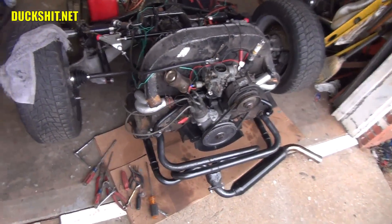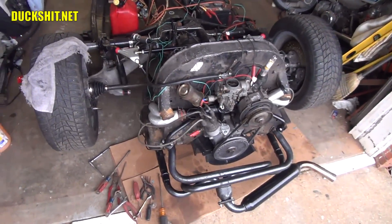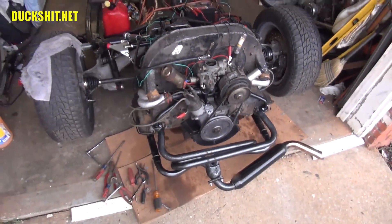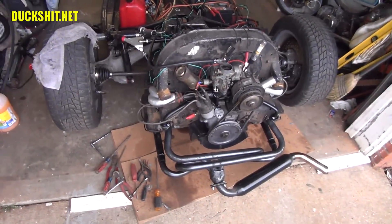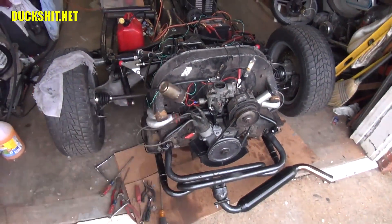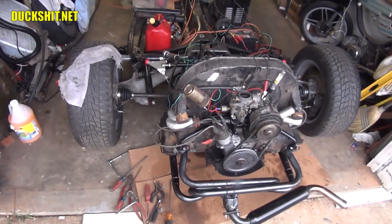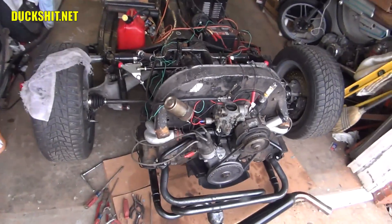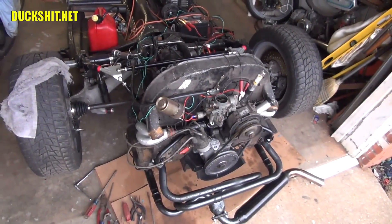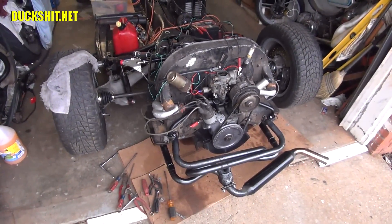I talked about it in the last Q&A video, where I asked people for suggestions on what carburetor settings they would use if this were either a 1600 or a 1776 using the 34-PICT-3 carburetor that's on here. These things have been really tricky to me. Over the years I really have not had a lot of luck with them unless they were set up previously. Usually if an engine had a 34-PICT on it and wasn't running right, if I took it off and ran a 30/31, I had much better luck tuning it. But we're going to put a 34-PICT on this one just because it's what I had.